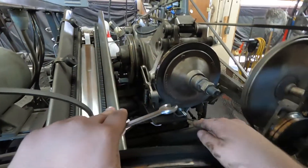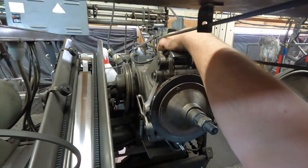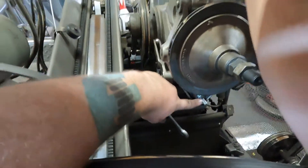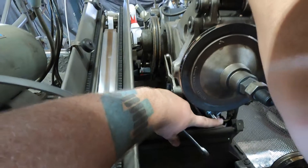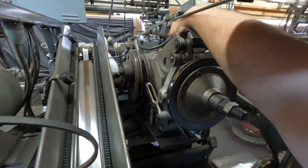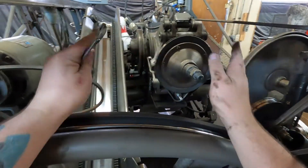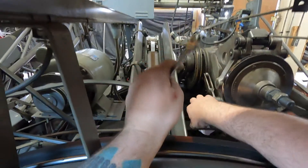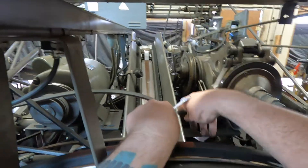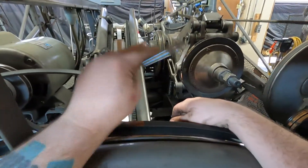Once you think you're tight enough, you can push that down and the yoke moves the adjustment screw. But when you go to pull it up, it has tension on it. At that point, that's basically it. You also want to make sure that the follower is touching the cam, which it should be already if your adjustment 7 was done properly.